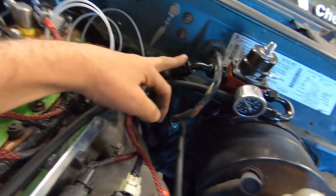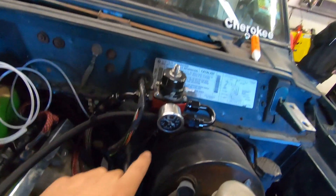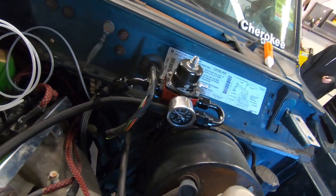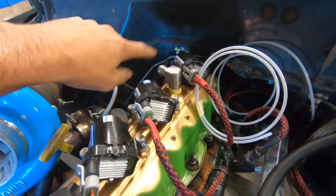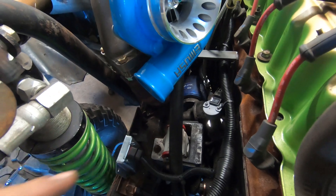We finally have our fuel lines plumbed. We have our feed coming from the filter to the regulator, then it goes to the fuel rail. The return goes back to the tank. We painted up our valve cover nice and minty, threaded it, and put a fitting with a barb on it for our road draft tube. Got the turbo mounted in, permanently welded the pipe, oil feed and return done. Got our wideband O2 over here — the driver goes to a gauge and also goes to the Megasquirt.